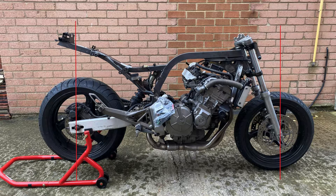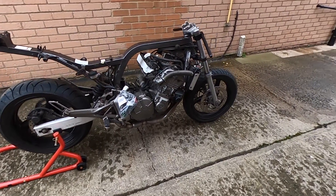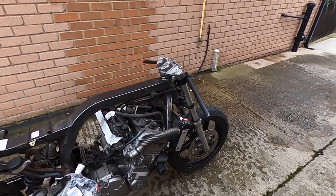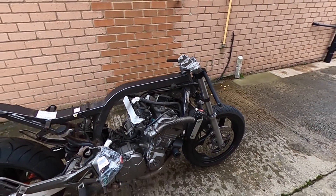These are your cut-off points — basically the center of the wheels. Anything after this makes the bike seem really heavy, but a small amount is okay. This is the height limit; anything above this will take away from the sleek line you're trying to get with a cafe racer, and it'll start to look like a flat tracker. I've put on some clip-ons which give it a better overall effect.